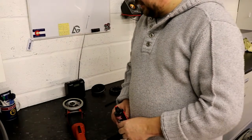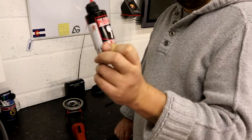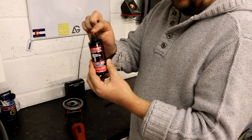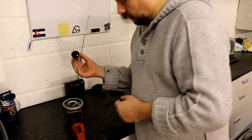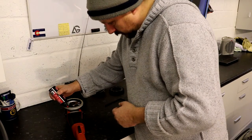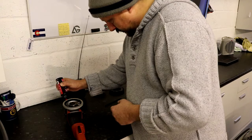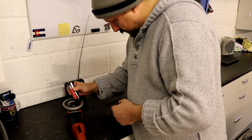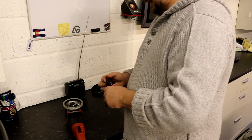Okay guys, so I have the tool open here and ready to use. What I do is get my air tool oil — it's got a lovely little open-and-closed dispenser which means it won't come flying out. You don't need to use very much. Just put this on there and go around the outside of it, giving it a very light squeeze to make sure every bit of the felt ring has got the oil on it. And that is done.